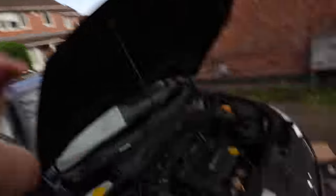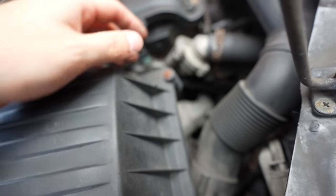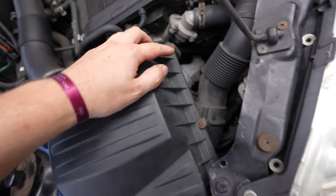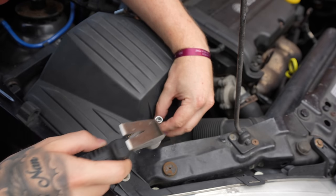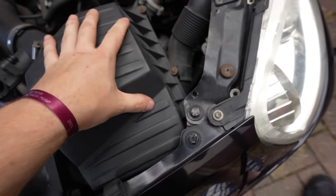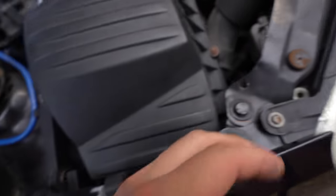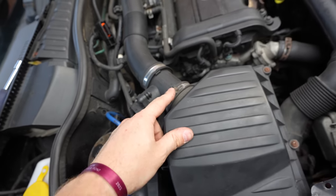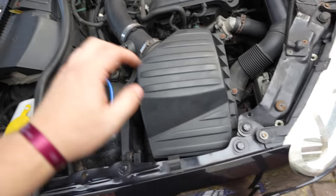I literally can't even get these bolts off — they're completely rusted on and I can't even get a head in the screw to try and get them out. I'm going to have to try the old-school method: just bang a flathead into them and hopefully grip them enough to take them off. Actually, there might be a better way without touching these screws at all — this little bracket here holds the air box in place, so I'm going to take that out, undo the intake hose, and hopefully get it out that way.